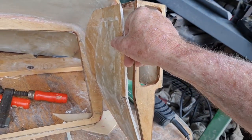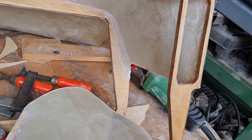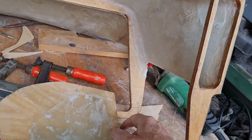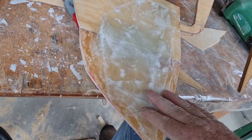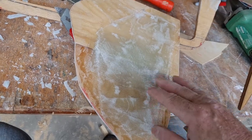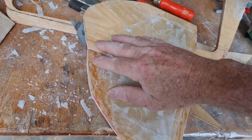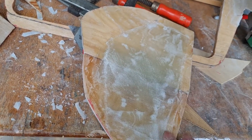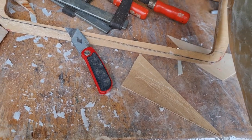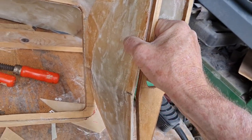I'm just making this side piece here to cover up the gap where that goes - it'll meet back in with the side of the boat. That's the piece where the remote goes in. Now I've glassed the inside of it because I can't get to the inside of it afterwards. I put some patches of glass on the outside, and the reason I did it that way was that I had to have it all clamped in place and couldn't get to the edges. I needed to hold it securely so I could take it off and glass the inside. Now I'm going to glue it in there.